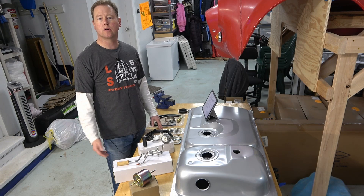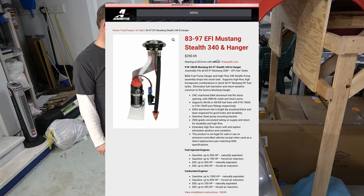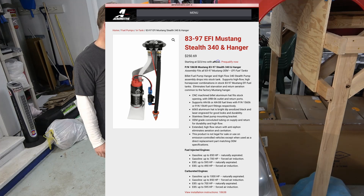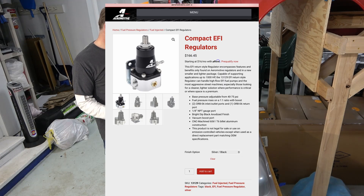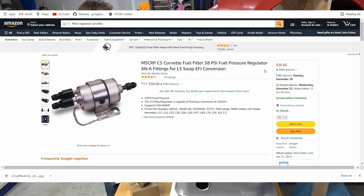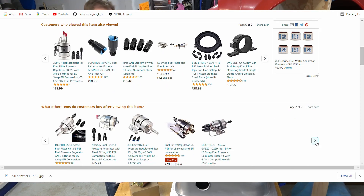The second resource I checked was calling Aeromotive Inc. and talking to one of their techs. He recommended an in-tank fuel pump as a direct replacement for my specific tank's fuel pickup, at the correct depth and ready for AN fittings at the top — priced at $250. He also recommended a 10-micron filter and a regulator. However, the Aeromotive tech discouraged the combined filter and regulator, saying Bosch no longer makes them, and many off-brand versions on Amazon are of questionable reliability.